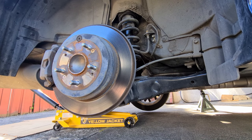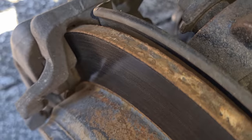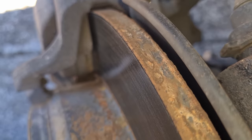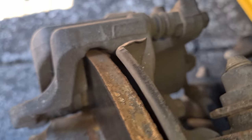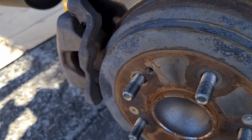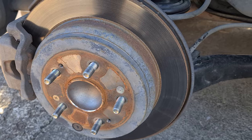This is the adjuster we're looking for — that one there. While you've got the wheel off, we'll check the condition of your brake pad. This one's okay but it's coming up to its service — it's about halfway worn. Just as an example. We'll go ahead and take the wheel off on the other side as well.